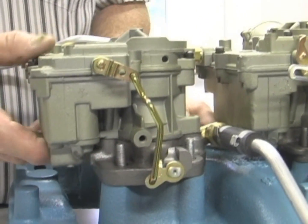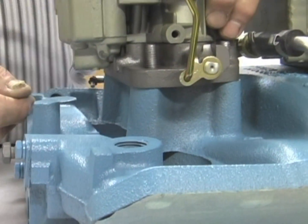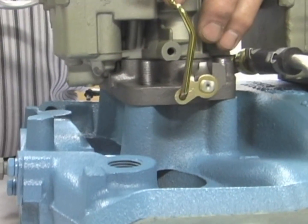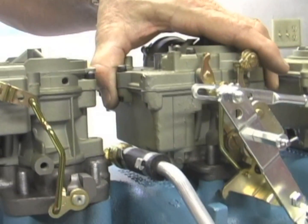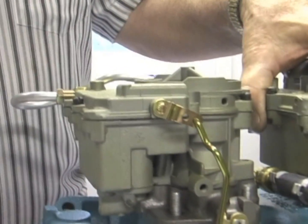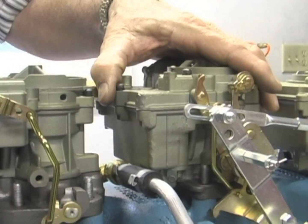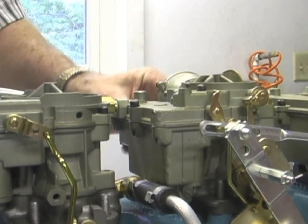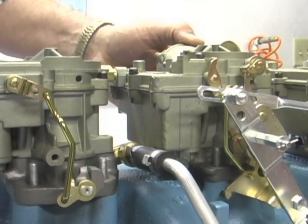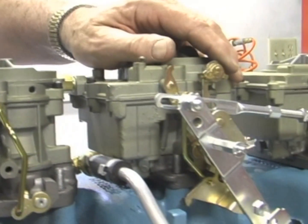The other thing you could do is put some insulators between the carburetors and the manifold — they look like a gasket and I've got them on the webpage. They're available in quarter-inch or half-inch thickness. I'd recommend the quarter-inch on the end carburetors, but probably the half-inch in the middle. They come with a kit with longer studs and raise your carburetor either a quarter or half inch, making very little difference in the geometry of the linkage. For the half-inch, I've got choke tubes that'll fit the raised carburetor, and for the '66 Tri-Power with the rod, I sell a rod with the kit to accommodate either quarter-inch or half-inch spacers.